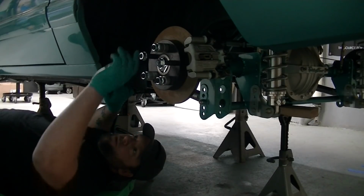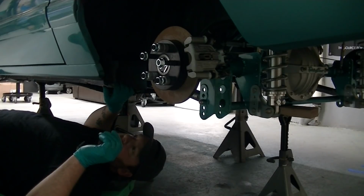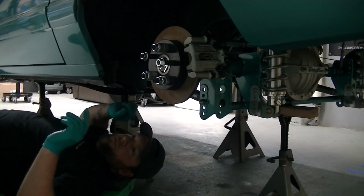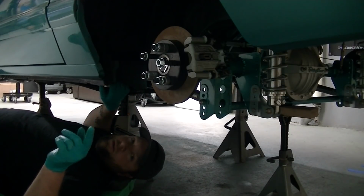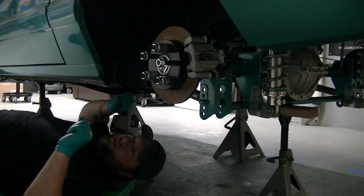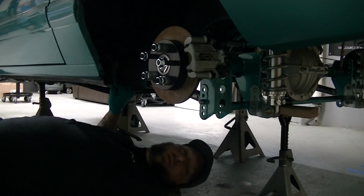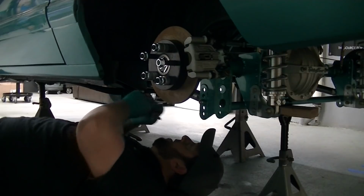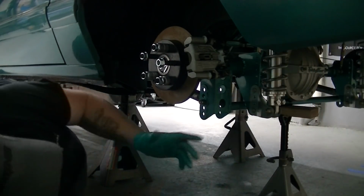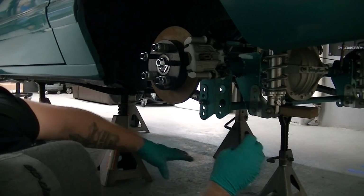Now, what I'm going to do is spin these control arms one at a time with the equal amount of turns. Alright? So you want to move both the same amount, so you try not to mess up your pinion angle really all that much. I gotta find my pen again so I can mark my control arms. Now I went 1 flat, not knowing how much a flat would change it.